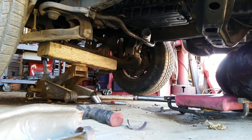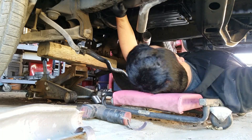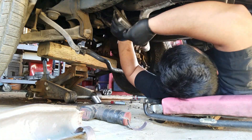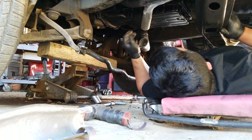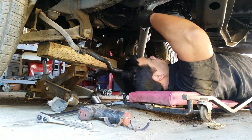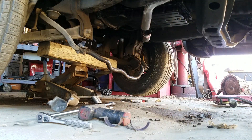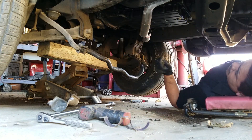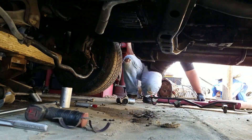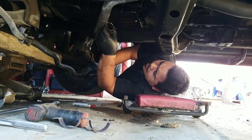I noticed that it doesn't actually line up perfectly to the exhaust on the other side, so I had to mark it and cut it down to get it aligned. I went ahead and cut a pie cut out of it so I can bend it into itself and give it the curve it needs. The way I'm holding the two pipes together in the middle is with an exhaust band clamp — because you don't want to slip one exhaust into another, as that's a hassle to take apart. You want everything to be removable as quickly and easily as possible.